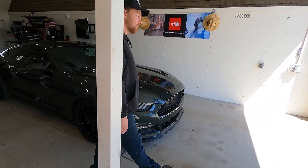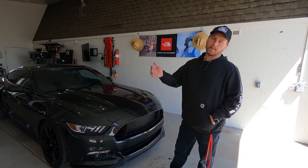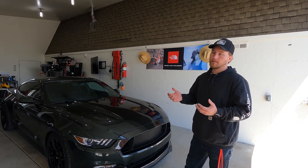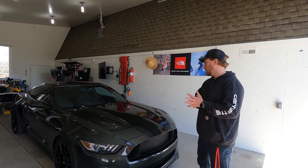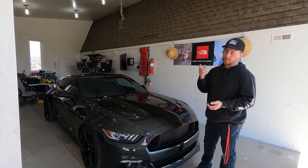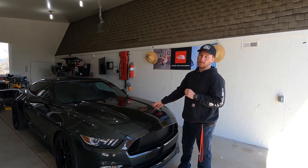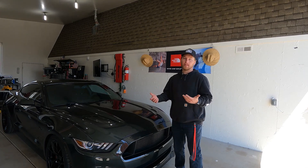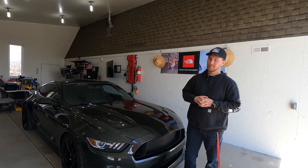Everything just bolted in. The only thing that wasn't exactly bolt-on was the ECU, which had to be sent to Roush to be programmed and sent back. The other option was going to a licensed Ford dealer who can program the ECU for the Roush tune. I also put a Ben Calmer Transmissions MT82 in it, and went with a twin-disc clutch to make sure the power could be held and it would be reliable for road tripping. Twin-disc also means you don't have to push as hard on the pedal — it feels like a stock pedal.